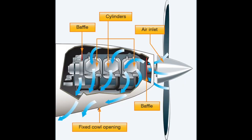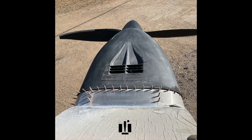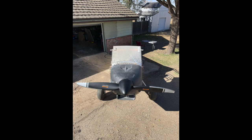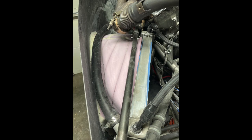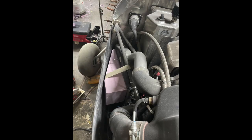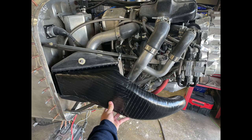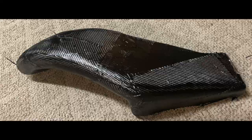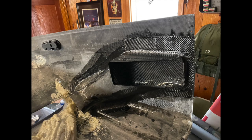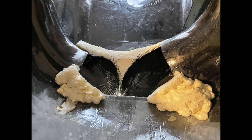Airflow over the engine will do very little for cooling, so I don't need the traditional vents on either side of the spinner. This allowed me to make a much more aerodynamic shape, more commonly found on turboprop aircraft, with a single intake down below to divide up for all my needs. I started making individual ducts to each core that got bigger as they went, with those diverging Mustang ducts in mind. There's tons of math that can be done to figure out the perfect aspect ratio, but in the end it's all dependent on the cooling capability of a given core — an unknown for me. I took an educated guess at the inlet size and call this approach the LAR method: looks about right.